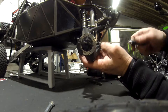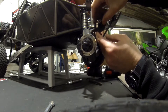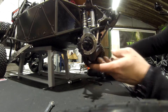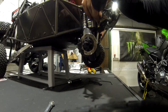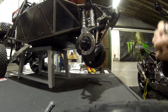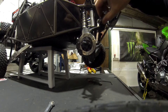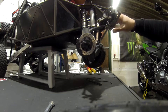The last bit goes manually so you get the feeling of the threads — very important. There's the other screw. You can get everything in aluminium for these trucks, but you have to have a breakpoint, so I don't want to have everything in aluminium.